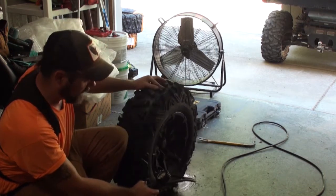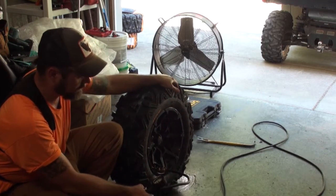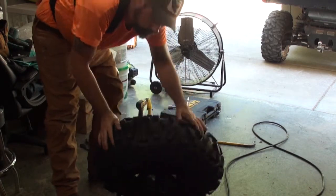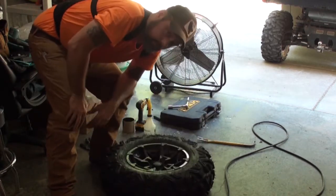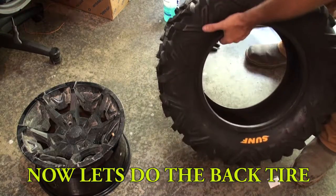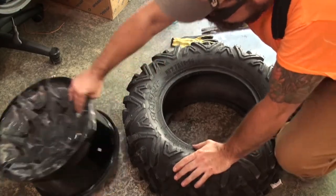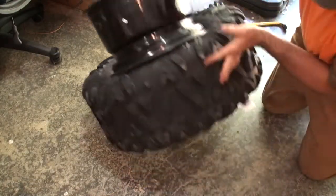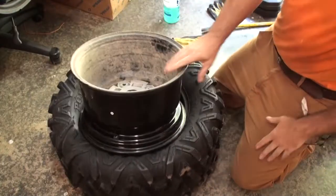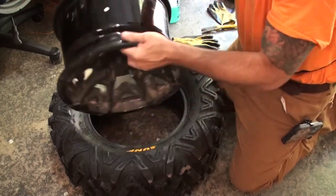Bead set — happened at 12 PSI. I'll fill it up to the pressure I like for my front tires. There's the other front tire done. Once again, these aren't non-directional — they are directional — make sure you put everything going in the same direction.